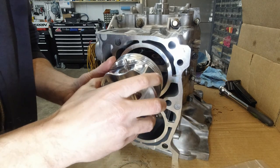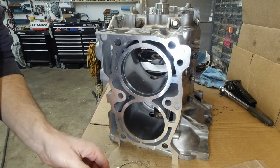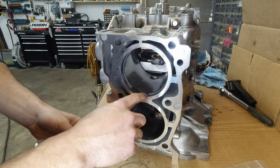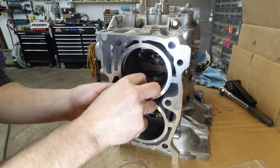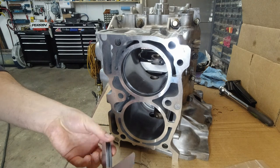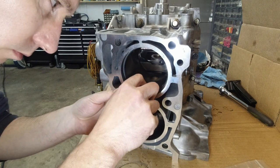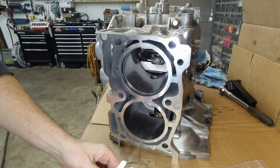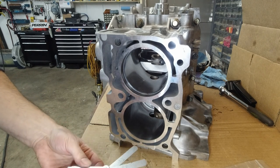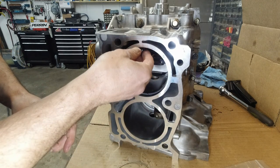Okay, so make sure the oil ring, every ring you'll put back in the cylinder, it's nice and even. And now these are usually set to a bigger gap than the other rings. So I got a 17 and 16. Let's go to 17, 18. Okay, this actually does not fit. So we're at 17 and 16. So that's 27, 33, which is fine. 33 thousandths is just fine. So let's remove this one.